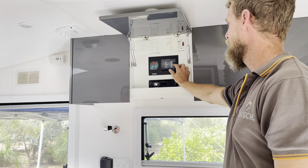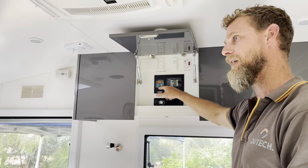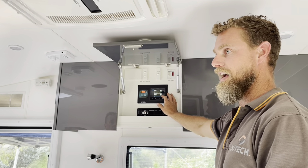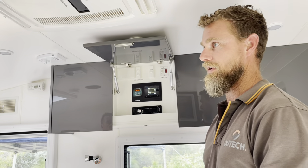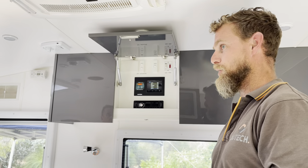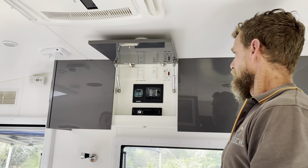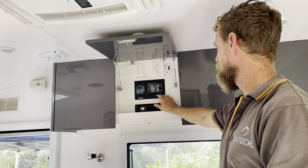That's just your battery showing what's happening - mimicking what's on the other page. And then you've got your two chargers, your AC charger and your DC-DC, which is also your solar. The battery is sitting at 100%, so there's only about two amps coming in - that's basically running the inverter because the inverter's on. So ideally if you're not using your inverter, just switch it off - it saves a bit of power. So then we roll through.